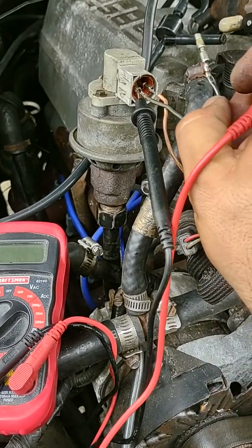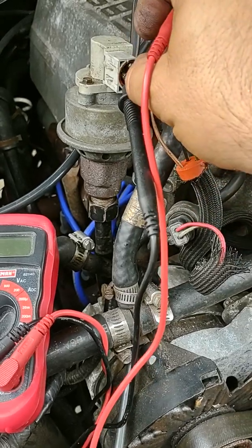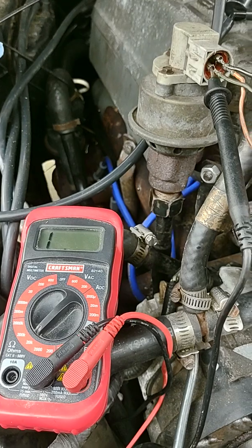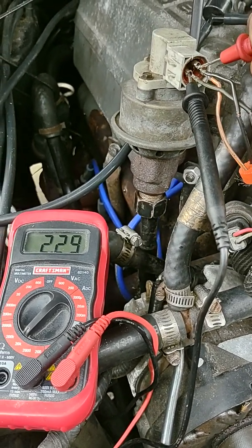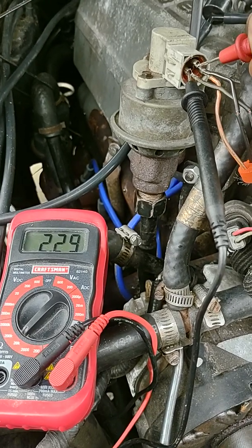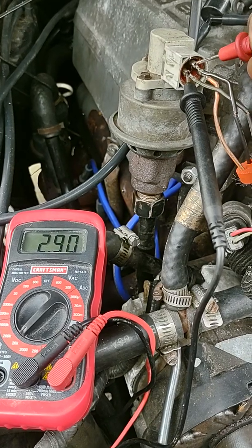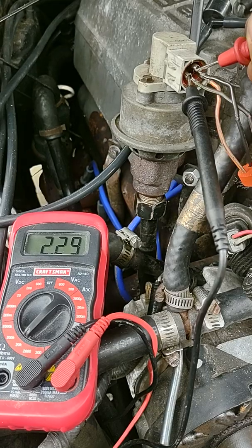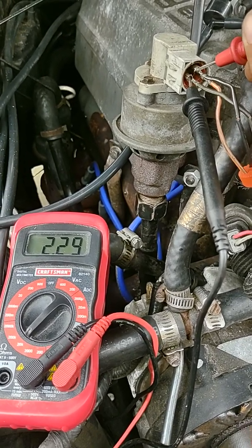This is it. Go ahead and plug it in. It is now plugged in the appropriate position. As you can see, I'm wide open. I'm gonna touch the pin. 2.23 k ohms. How in the fuck does that happen? I mean, obviously this connector right here is bad, but wow, that is just freaking impressive. Like, I'm not even on the wire, I'm on the terminal itself.